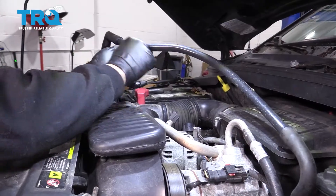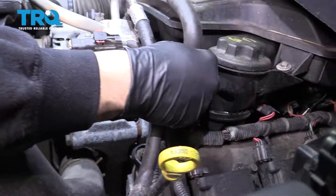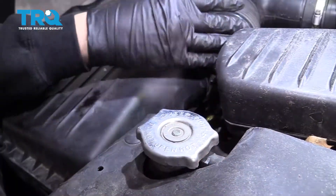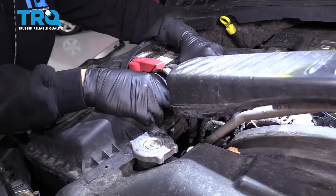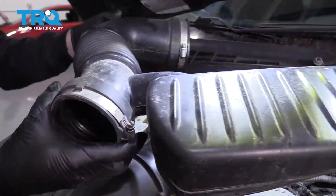We're going to remove the bolt. This tube that we just connected from the air box comes over here to the side of the oil fill neck. I'm just going to slide that off and set this aside. Now I'm going to go ahead and pull this unit up. It might be easier if we pop this and then separate this, and set this aside.